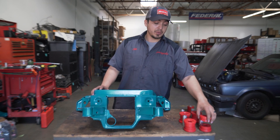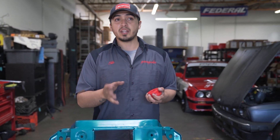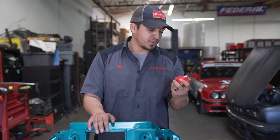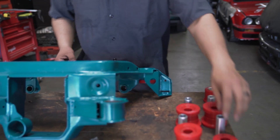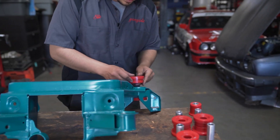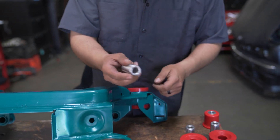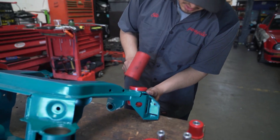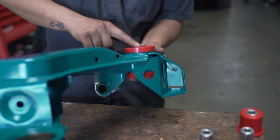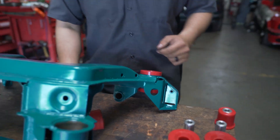Because it is the 80A durometer, it's a little easier to install versus the aluminum or the Delrin, where you might need a press or possibly a mallet to smack them in — you'll probably need a press for the aluminum ones. This one is the lower rear, so this is the rear, this is the lower, and you can see just by hand it can go on. The top rear bushing goes on here and that goes in. The rear takes the bigger inside diameter race — just push that in. You might need a rubber mallet to tap it in and get it flush on both sides.